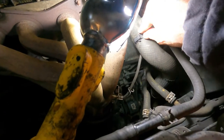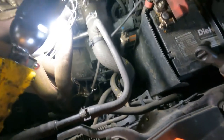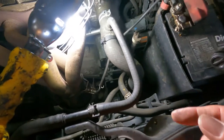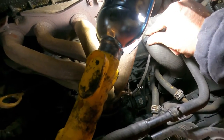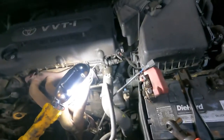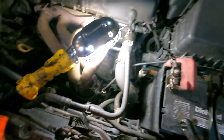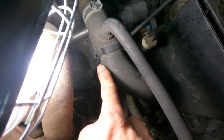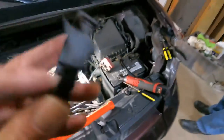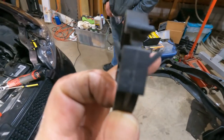They've got a little clamp around this holding this cable in place. We're going to try to figure out how to get this off so we can put it back, but if not I'll just zip tie it — I may just cut this and zip tie the new one in to keep the cord from dangling. Looks like I can put pliers on this and get it unhooked. Quick update: I just squeezed these little ears on that connector and it popped open, so we will be able to reuse it. Just squeeze these two ears together — you can see those little ears sticking out — I grabbed them with some pliers and it opened right up.